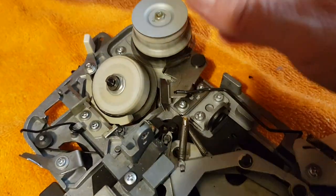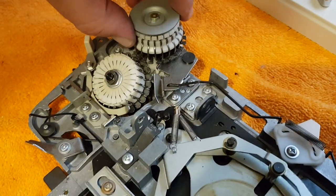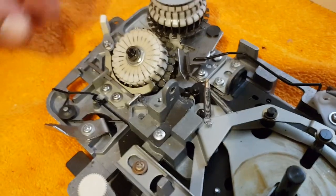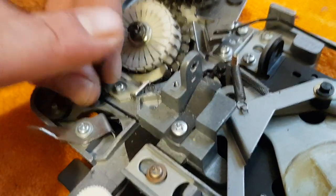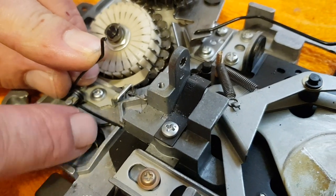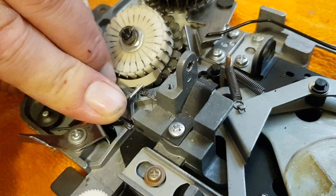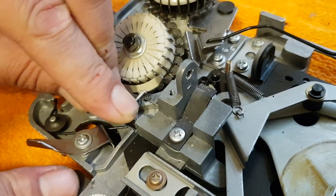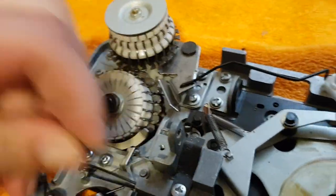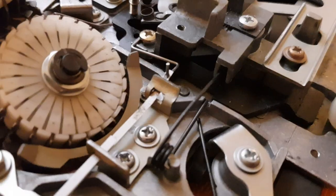Your last job now — you can see it spins very nicely. Your last job is to reset this spring, and that's actually quite easy. What you do is take the spring, make sure it's upright, push it down under this piece here, underneath. There is a slot underneath there — and there it is. If you look right through there, you can see the little slot that the spring is fitting into. And that's all done.